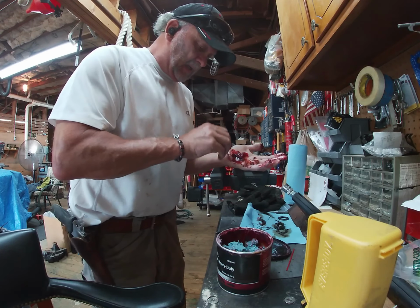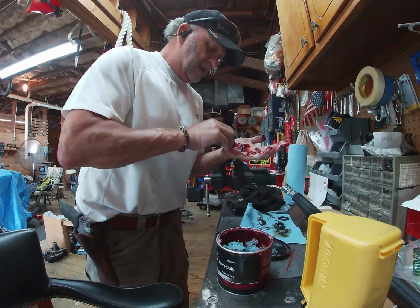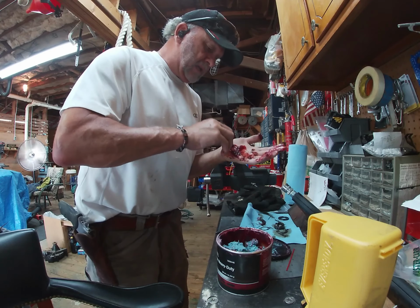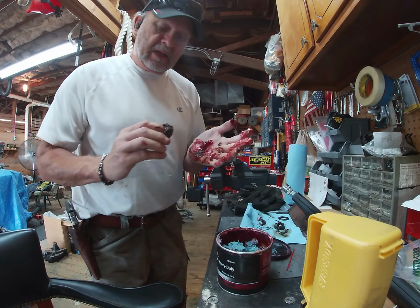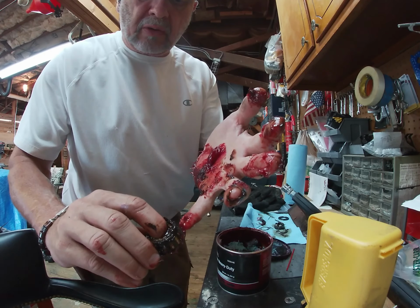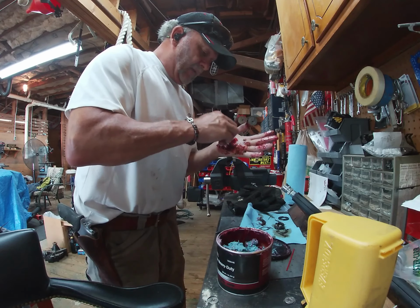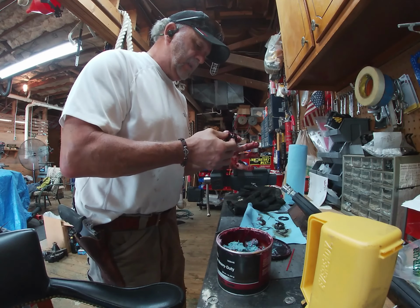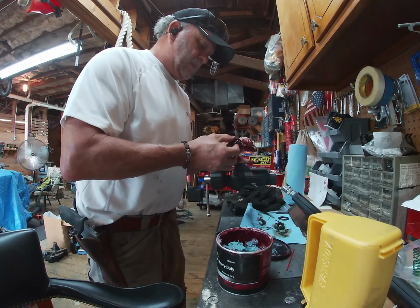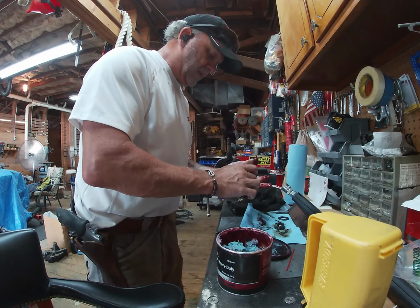to pack bearings, and I don't think it's a big secret, but you just get some grease in your hand and you nibble at it with the edge of the bearing. You can see it's purging the old crap out the top while packing in the new stuff on the bottom. It works out pretty slick. Gets all the old crap out of it, that's for sure.